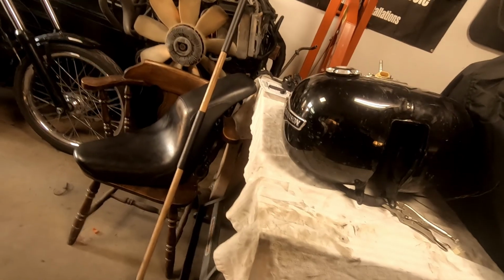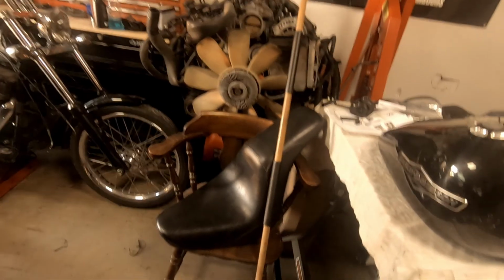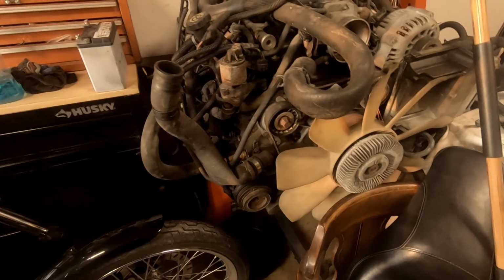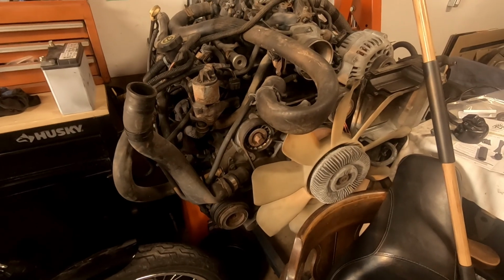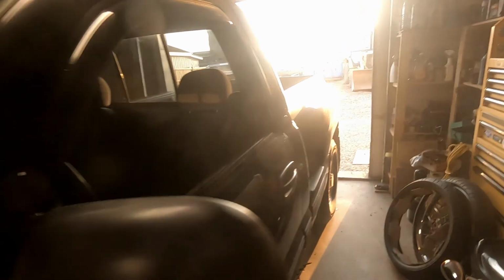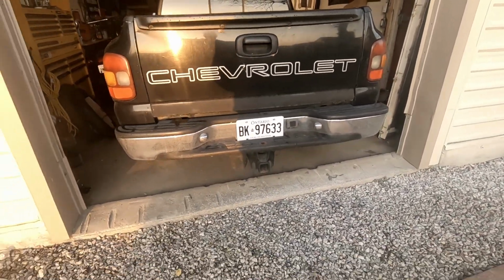So we got some headers for the 4.8. Well, I got them for the 4.8. Now I'm tempted to put the 6-liter in this thing and go from there. So feel free to leave a comment and see what you think, 6-liter or 4.8. It's got 317 heads on it, so it won't breathe the best, but it'll probably be more than enough for this old farm truck. But we're finally getting her cleaned up. I'm driving it every day now, so got plates on it. But coming along.